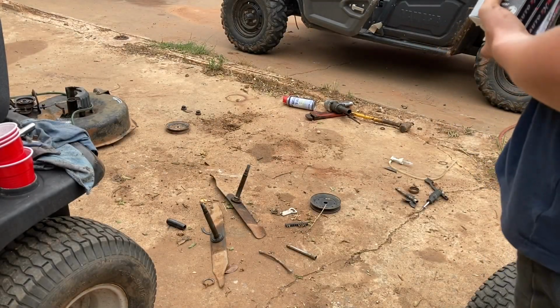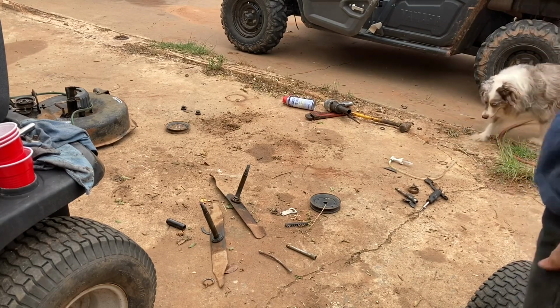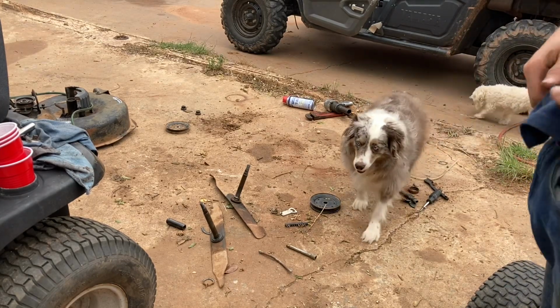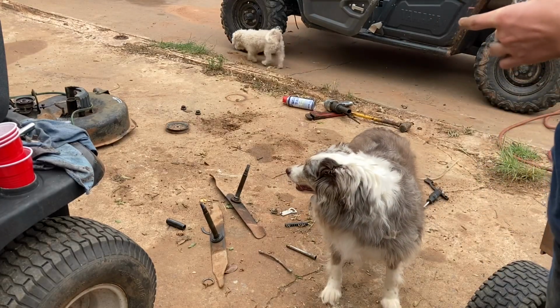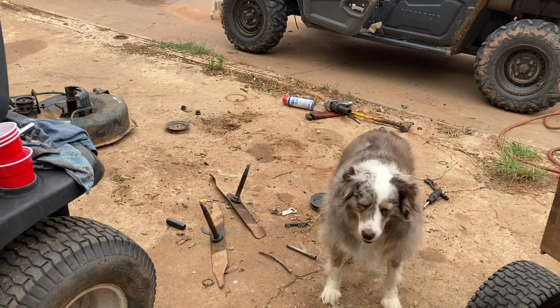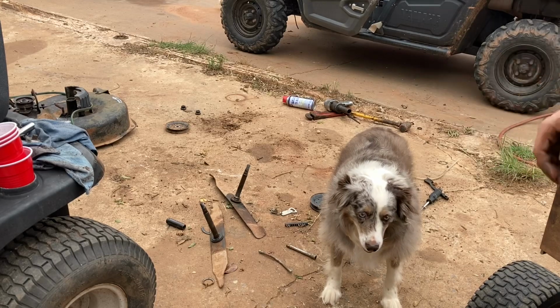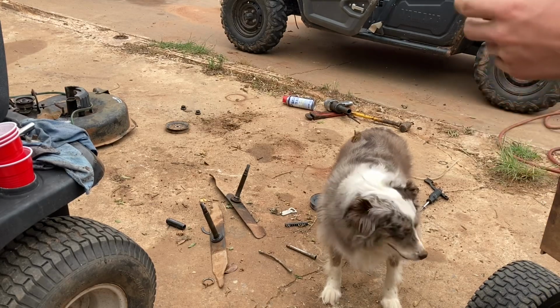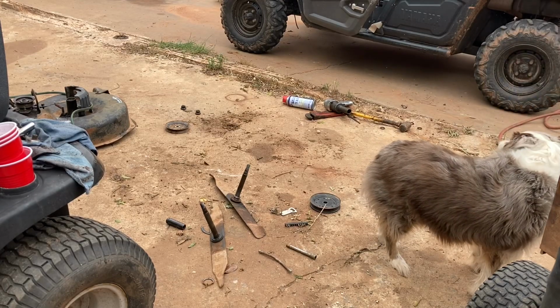Gunner come in. Today we are back in the workshop again. And today we're going to try to get this old Craftsman to mow, which you can't see right now, but that's because we're working on the deck. So I was servicing the deck, you know, made sure the spindles and everything moved freely and the idler pulleys did. Idler pulleys moved free, but the spindles did not.